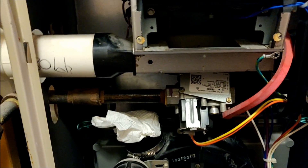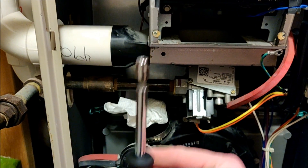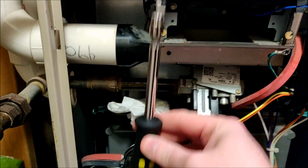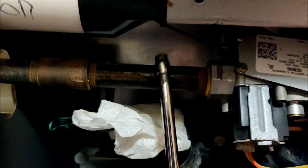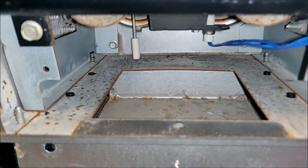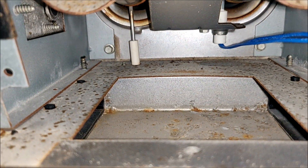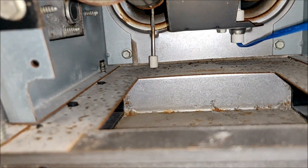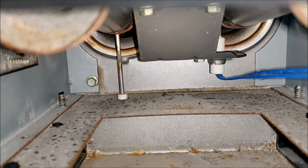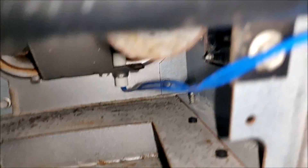In theory the flexible socket was going to be the answer, but the screw was so tight that we ended up just using a regular socket on an extension on a handheld screwdriver, getting it behind the gas pipe and straight up, and were able to loosen the screw — you can just barely see the tip of it now. I'll do the rest by hand, and then the flame sensor will slide right out. We got the screw out and are pulling down on the bottom of the flame sensor from underneath by hand, following the wire back a little to work it out.